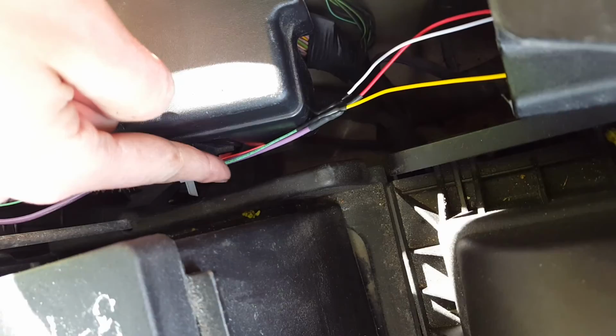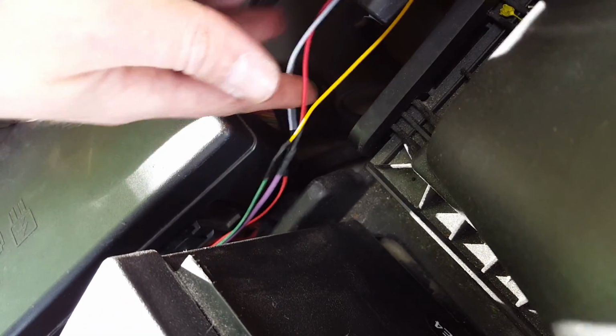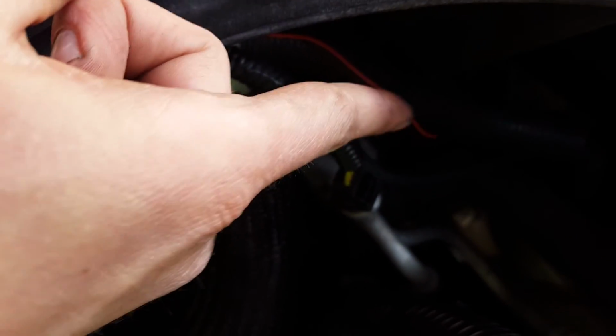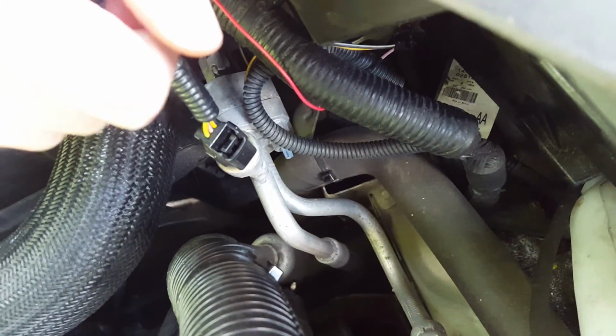Then you go around here, and then you basically go to the first bulb, which is down there now. At the bulb you connect the parking lamp to the output of the daytime running light, which is one cable coming out. I go down to the bulb, to the parking light, and I cut the parking light there. Then I run another cable from there all the way to the right one, cut the parking light there too, and then connect the output on this side also. So that's basically how you get power in there.